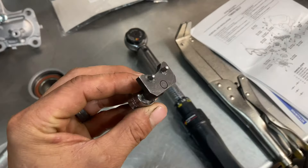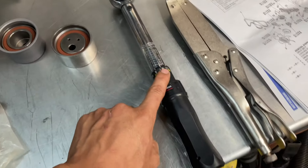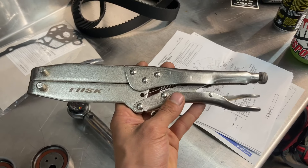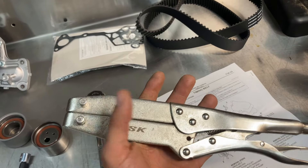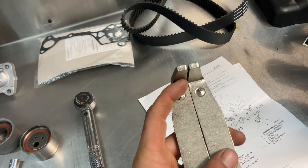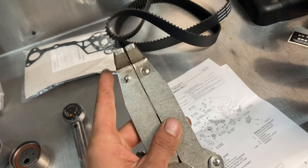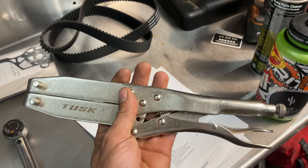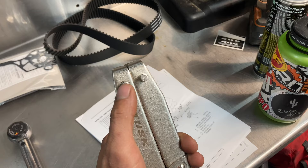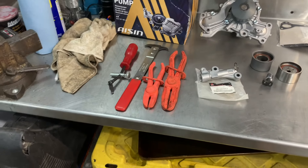Along with that tool you're going to need a torque wrench that goes pretty low — this is an inch-pound torque wrench. Also useful is a specialty tool actually made for holding a dirt bike clutch; if you go on Amazon and look up 'Tusk dirt bike clutch holder,' I like this tool. It allows you to grip the camshaft sprockets evenly when they move, because they will move when you pull off the belt. I've seen horror stories of people breaking their camshaft sprockets doing this job. It's also helpful when taking off or tightening the crank pulley.